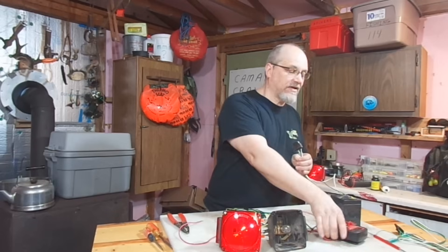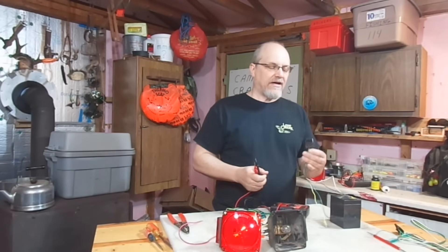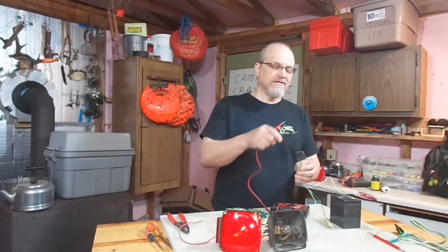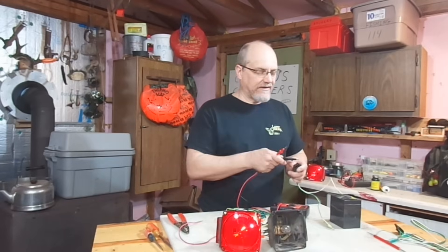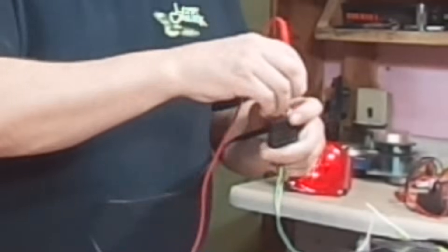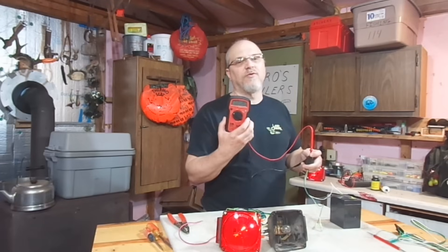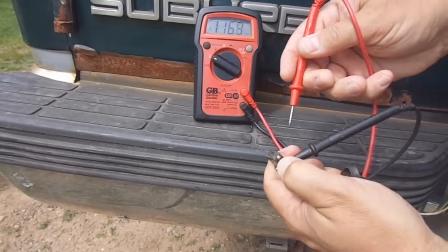So we could go to our plug — this is another example of using a multimeter to measure DC volts. It's pretty easy to figure out which color wire goes to what part of the plug. The white wire is on one side, so to measure DC volts, we take our black lead and put it on the single exposed pin — that's the ground or negative pin. Then we stick the red lead into the brown pin next to it, and lo and behold, we've got 12.5 DC volts. That's another example of measuring DC volts to help troubleshoot trailer lights.